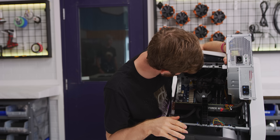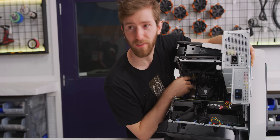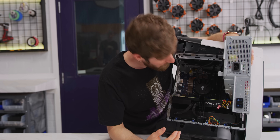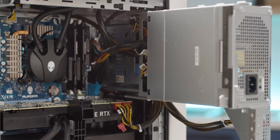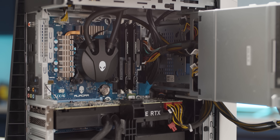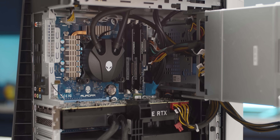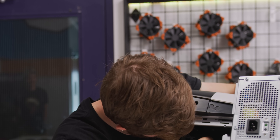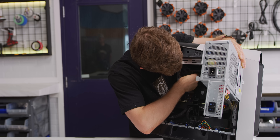But enough teasing Dell about that. The eight pin is actually a six pin — did you notice that? It's missing two conductors. I know you don't actually need however many watts that connector carries for a mainstream CPU like a 10900K, but would the board run if you put an eight pin in it? If I plug just six pins into a regular eight pin connector, would it work? I know that four pins will also work in most cases. Yeah, the motherboard has the pins there.